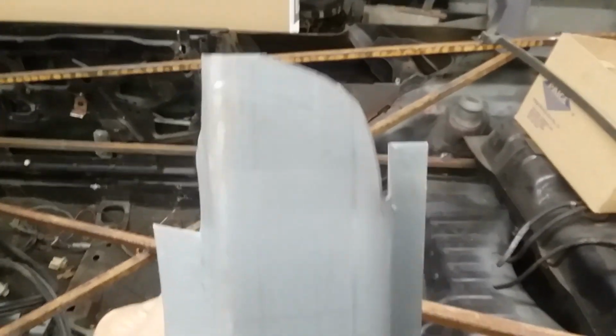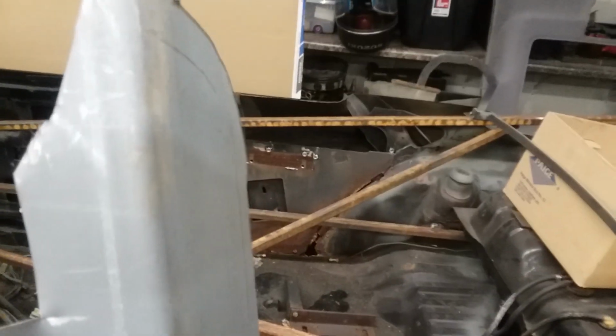That's this corner. Now, this is the corner. It goes right there. It's that nice, pretty rounded one, and they didn't bulge it out, which is fine. I could easily do that. I'd want to do that anyhow, with a few sets of pliers, hammering mallets and hammer dollies, maybe even an anvil, so I can have that shaped just right.